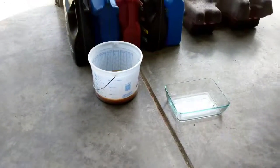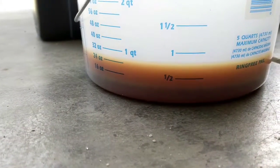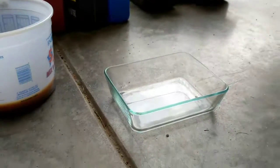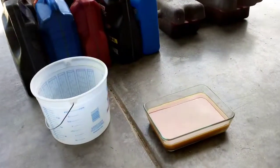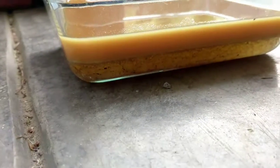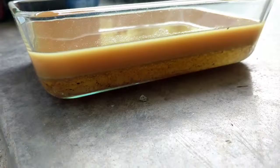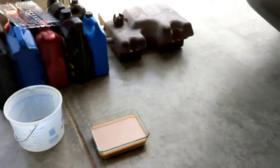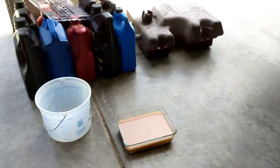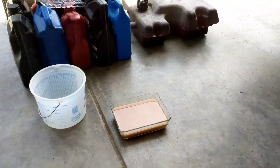I'm gonna try to see if you can see the separation of water and gas. I'll pour it in the glass and come back and look at it — there was a lot of water in that tank. That's the separation — it's about half and half water and gas. So what I'll do is pour some rubbing alcohol in the tank. Rubbing alcohol will mix with water and it's still flammable enough to run this thing, so whatever moisture is left in there will be mixed in.